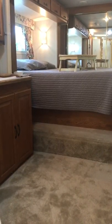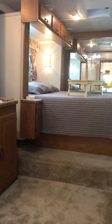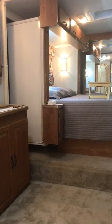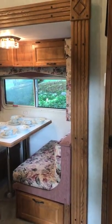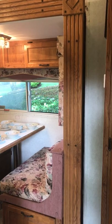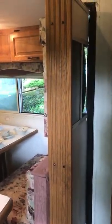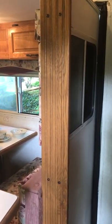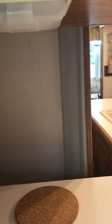They are sequential. Starts with the bedroom slide. And once the bedroom slide bottoms out, the dinette slide will start coming in, as well as the galley. And the galley finishes last. It did draw in a little bit. Sometimes pressure does that, but that is the last slide to come in.